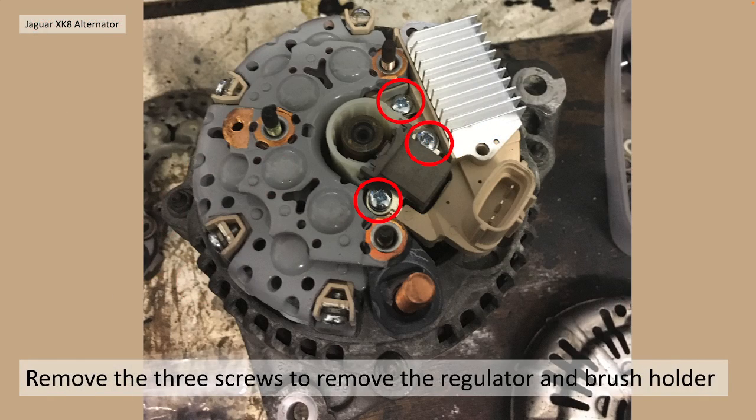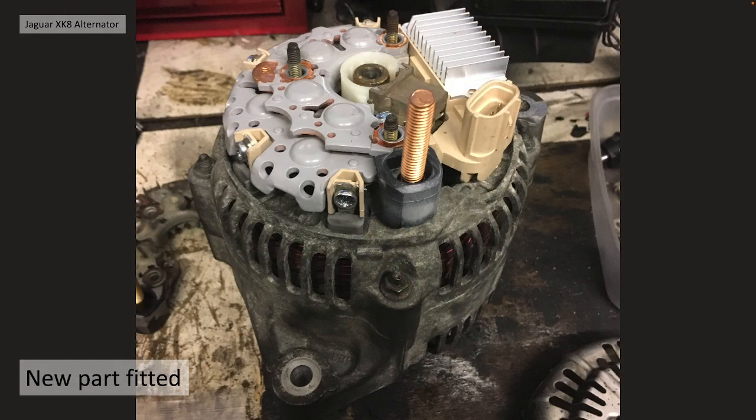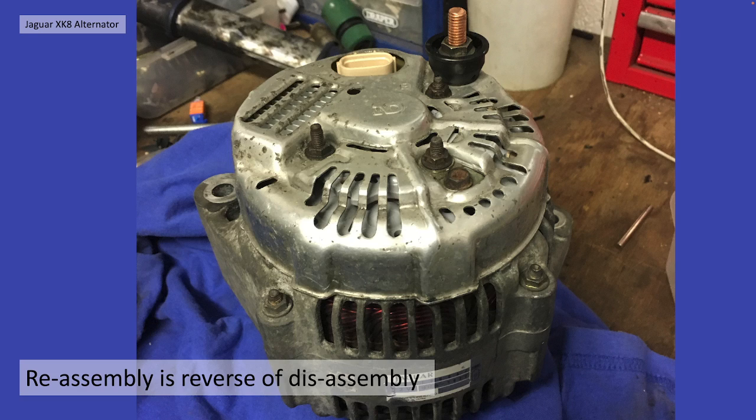In order to remove these components, you need to remove the screws and the regulator. You need to remove the three screws to remove the regulator and the brush holder, as I've circled there in the middle. To actually remove the regulator, there are four actual screw points around the circumference of the alternator — they need to screw out horizontally to remove. You can see them a bit more clearly in this picture, which shows all the new bits on, so it's looking quite clean. Reassembly is the reverse of disassembly, and fingers crossed you've got the right parts and everything's okay. I was very lucky — it worked for me.